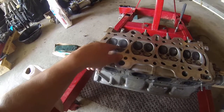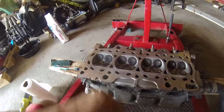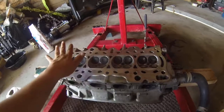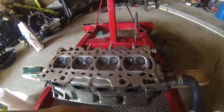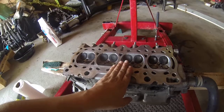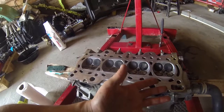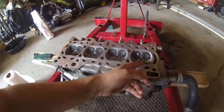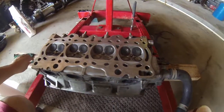So I kept the spark plugs in there, plugged the hole so there was no seepage, and poured chem dip individually in each combustion chamber. Let it sit for about give or take two and a half hours and came back out. It says not to let it sit for four hours, because the aluminum's porous and it might absorb a lot of that chem dip, which probably wouldn't be good. So I came out here with the toothbrush — just a regular old toothbrush that we don't use anymore — and cleaned all that out.